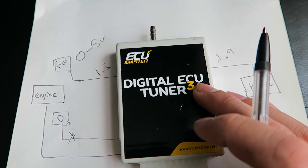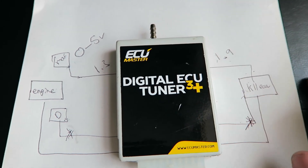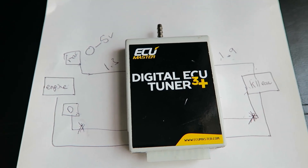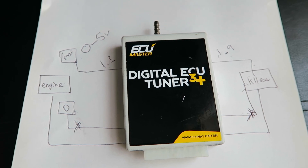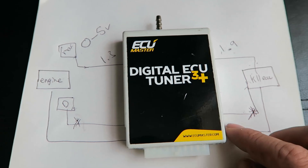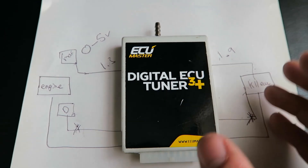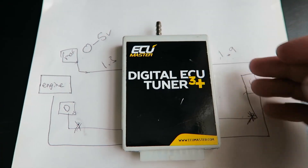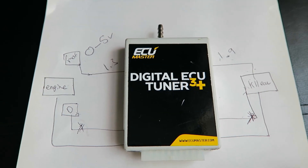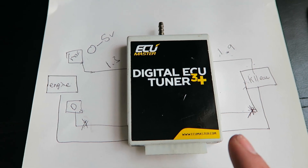As you can see, it does give you timing control and fuel control, however in a very basic manner. Some ECUs don't like being messed with in this way. The K11 can sort of go into closed loop or open loop randomly and it overwrites some of the adjustments that you're putting in. If it's got the lambda sensor plugged in, sometimes that can override it because it reads the lambda sensor reading and makes a control without this in the way - it effectively cuts it out of the loop. It's all very hit and miss and you find that your AFRs tend to be quite messy.